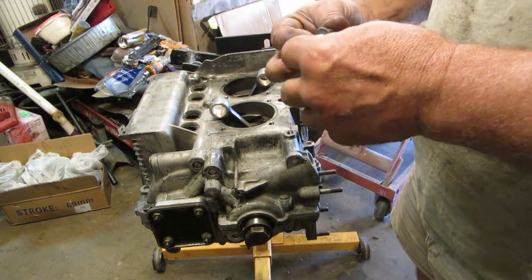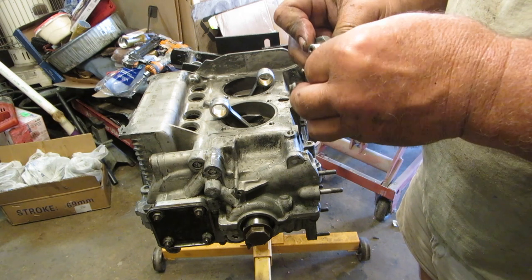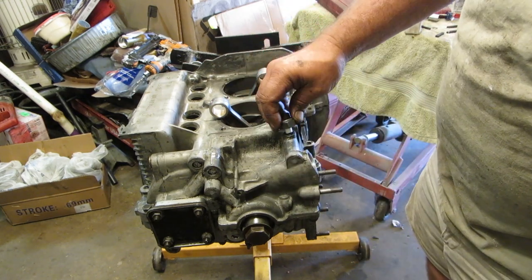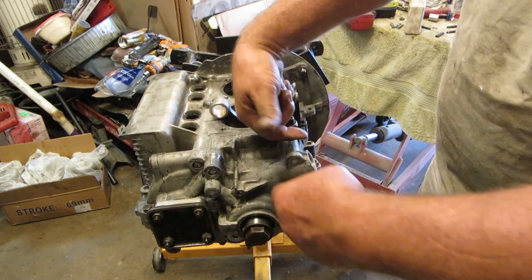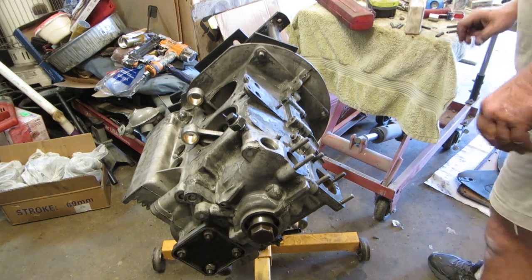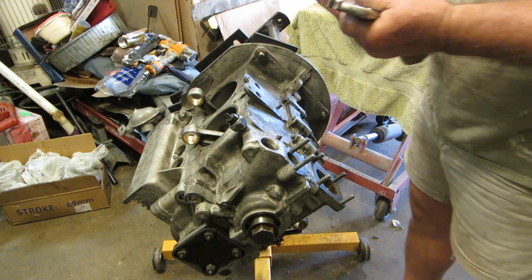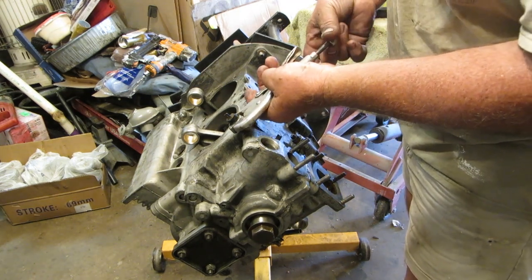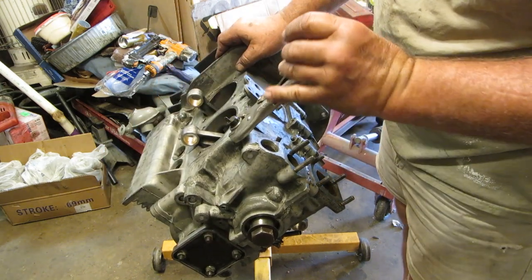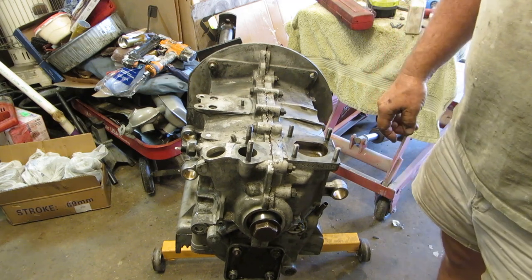Next is going to be our pressure switch. If you wind against the thread, that is opposite of the thread, see, we're going to wind left instead of right. So when you thread this in, since the tape is going this way, it's not peeling all off. And we'll tighten that up. I don't know what size it is. These will fit it though. You don't need to bottom that out in the block. You'll feel it tighten up, and that should be plenty, especially with tape on it.